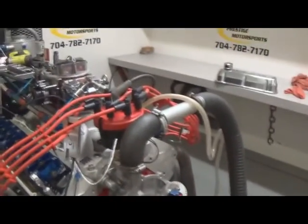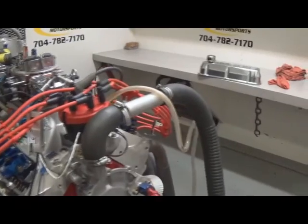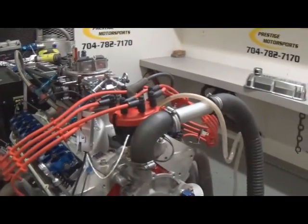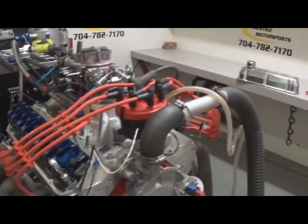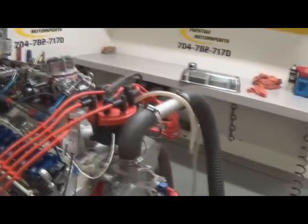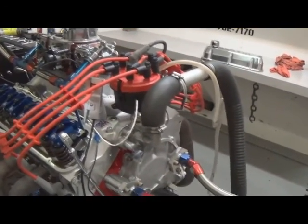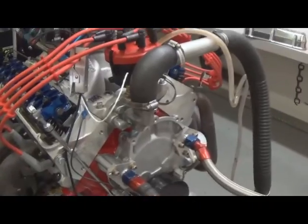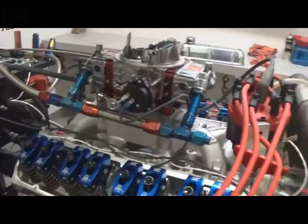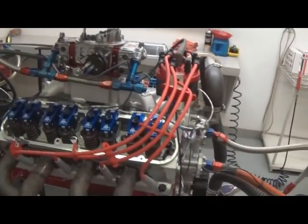You'll get a tag that comes with the motor. Don't lose that tag — it'll give you two specifications, one at 1,000 RPM and one at 4,500. The 4,500 RPM spec is the really critical one; just rev it up and that'll be full advance. Typically it's 32 degrees, but look at your tag. When it comes back to 1,000 RPM, it'll give you an RPM that it should be at. Naturally it's in the curve, so it's going to bounce around a bit. Definitely check it when you fire up — you never know if it's moved.